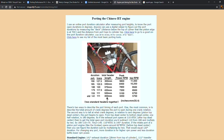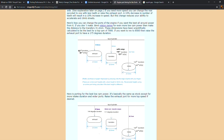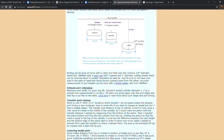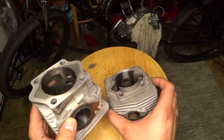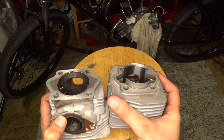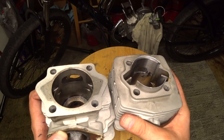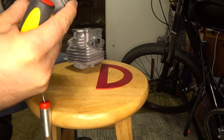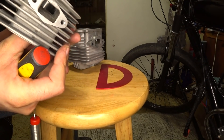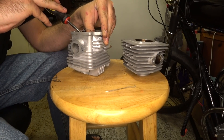I'm not ashamed to admit that at the moment I'm unsure as to what has a greater impact on RPM limits and RPM peak power — the pipe or the ports. I assume they work in harmony, with longer port duration having potential for higher RPMs and the pipe giving the added boost needed to reach the desired RPMs. I've been fortunate enough to have a bunch of different cylinders on hand including the Phantom 85. When comparing the performance and port times of these different jugs along with online resources, I found that our main limiting factor is going to be the transfer ports. With my current available tooling, it will be difficult to get the desired transfer duration while maintaining a consistent roof angle. We will revisit the transfers later in the series when we have better tooling, so for now we'll focus on the exhaust and intake.